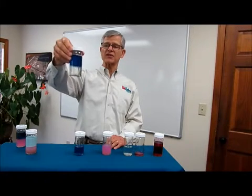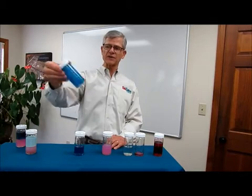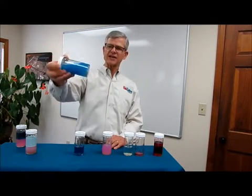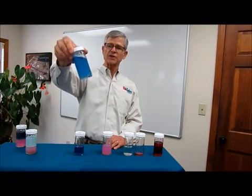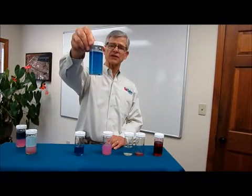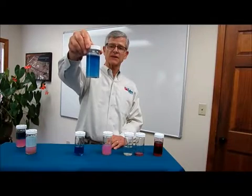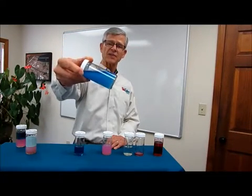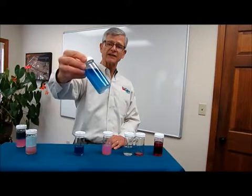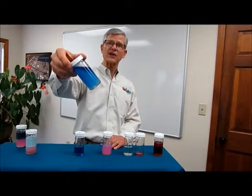In this case, we have diesel sitting on top of water in equal proportions, and if we shake that a little bit, we get a bit of a mess. If we look closely at the jar, we can see that the diesel and the water are beginning to separate really quickly after I finish shaking the jar. There are little droplets of fuel being deposited on the glass, and those are going to stick to the glass and not be easy to clean off after they dry.